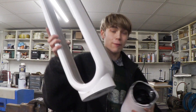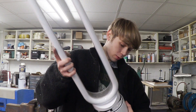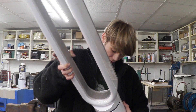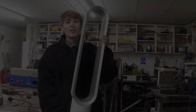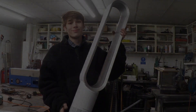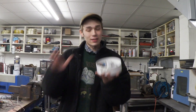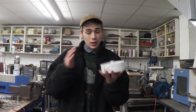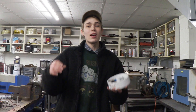So that is the motor cleaned up and put back together. Now we can put our big bladeless fan ring back on, and this has to go in a specific way so it might take a second. That was a bit of a struggle but I managed to get it back on. Now this circuit has been cleaned up and the motor has been attached, it's time to put this back on. So all I'm going to do is reattach the wires, screw it down, and then we can plug it in to see if it turns on.